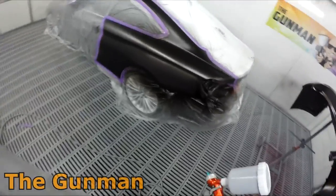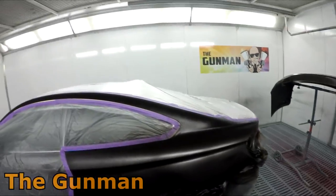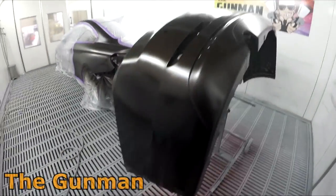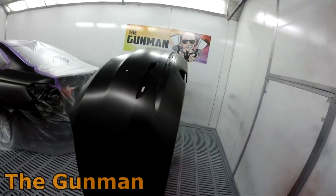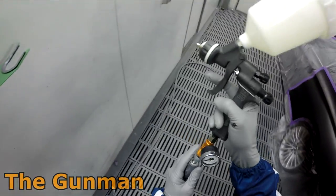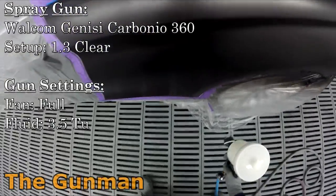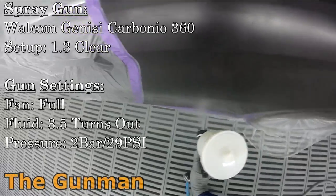That's our base coat just about sorted. As you probably noticed, I did put three coats down just to ensure I had coverage. You could just about see that it was covered after two, but it can never hurt to put that last coat down just to be sure. That's my rule of thumb with solvent anyway — get it so that you think it looks covered and then put another half a coat on, just sort of an effect coat, especially for these metallic colours. You want those metallics to stand up nicely. If you go and put the third coat on too wet, the metallics can sometimes lie down because the paint's actually starting to flow, and those metallic flakes can start to lie down — you'll actually get a bit of a different look as well.